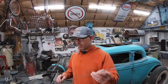So I went to Lowe's just because it's convenient. This is, I think it's like 3/16 rod, just round bar, as you can see. What I'm trying to do is to create some integrity, a little bit of structure on this panel, not to mention give it a soft edge on the outside. Because remember, I am going to wrap this in that vinyl, and I don't want the sharp edge of the metal to rip or cut through the vinyl.